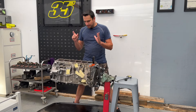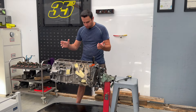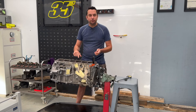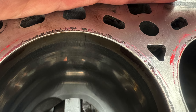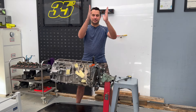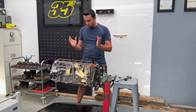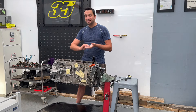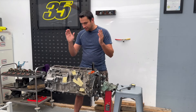Looking at the block, it doesn't actually look that bad. However, upon further inspection, when I clean all of the cylinder walls and start to inspect them, the cylinder walls have this deformation — it's very hard to capture on camera. Basically, when you get to the very top, they're doing like a flare, slightly deformed, probably about 10 millimeters before we reach the top of the deck. This is causing air or oil to escape, and that's the reason why this engine was blowing a lot of oil. What makes it even worse is the wear on cylinder number three — it's just amazing.